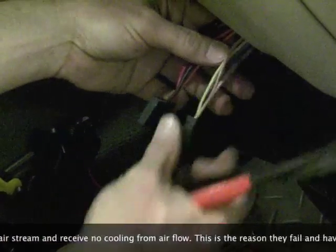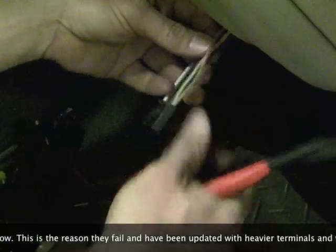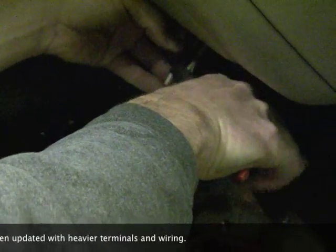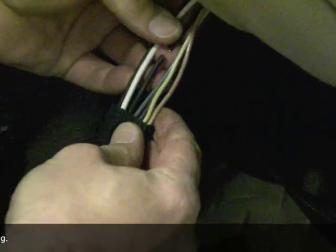Then what you have to do to get everything to line up just right when you get it going back together, you go back and cut an extra 1/4 inch off of your 1 black wire. That's going to, by the time the joint's together, make it the same length as the original 3, or 4, I should say.